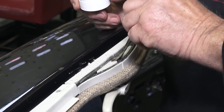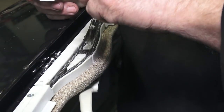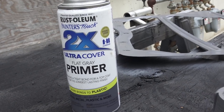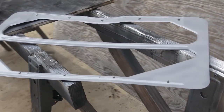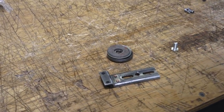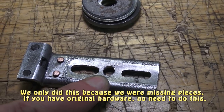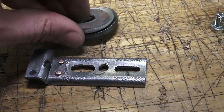My dad dabbed the silicone grease on the cables — this seemed to work pretty well and kept things clean. If you have another method of greasing these cables, let us know. While he was doing that, I grabbed the center steel piece that the headliner gets wrapped around — I primed and cleaned it up. Getting back to the sliders: the original two holes did not work, so we had to improvise and make our own center hole, which lined up better.